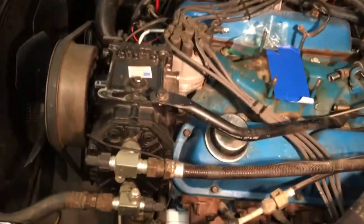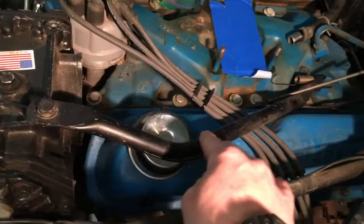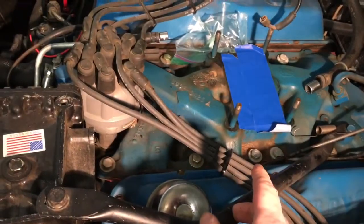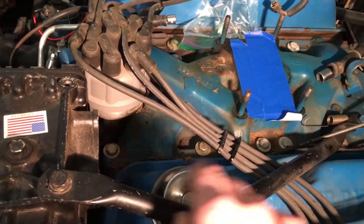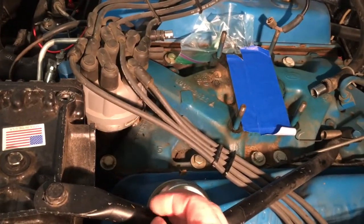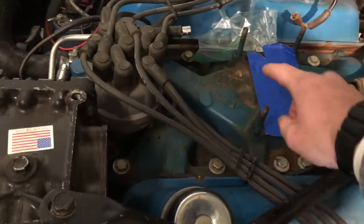I said I wouldn't modify this car, but dadgummit, I want to take this bracket off. It is just right in my way. While I had the carburetor off, I decided it'd be a good idea to just go ahead and check the intake bolts, and sure enough, all of them were less than 10 foot-pounds. Even though this is a cast iron intake, they still loosen up.